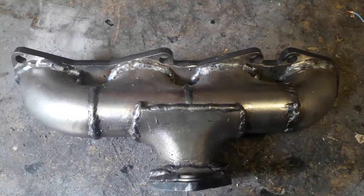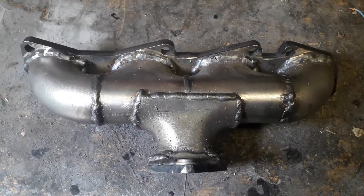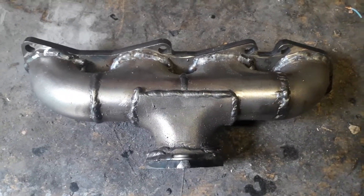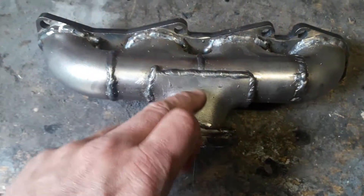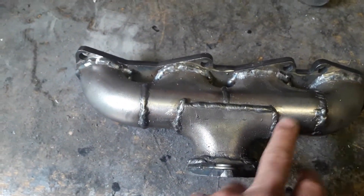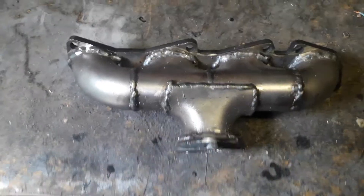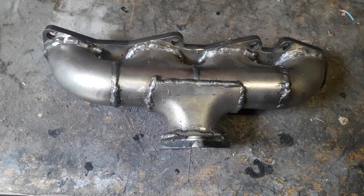To my way of thinking, the standard position is a lot easier for positioning the turbo because it allows air conditioning to be retained. But for me, air conditioning is not a primary issue — I want maximum power, maximum spool and everything else. So I fitted the outlet in the middle so that you're getting as even a flow of gases as possible into the center of the manifold and then outwards, which hopefully should help spool a little bit.